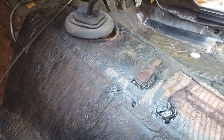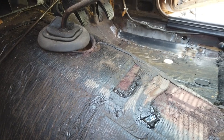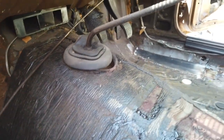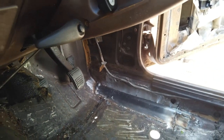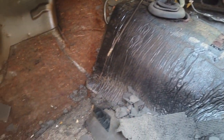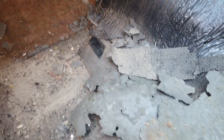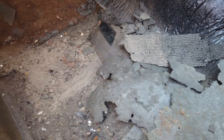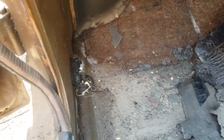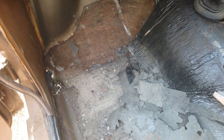Still a little bit of welding to do on that side - couple of holes to close up. I just want to break the back of it, and some grinds to clean. I'm out of sanding belts, that's why we've not gone any further. So: bin bag this up, vac, screwdriver flat blade to take off this kick panel, vac and wash - that's the job next before we do anything.